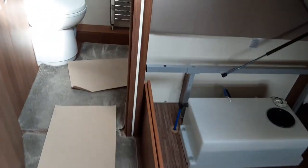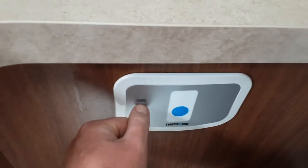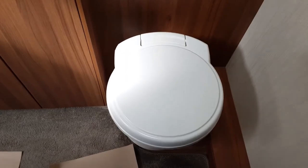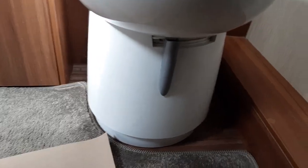The last thing to go through on this particular caravan is the toilet system in the bathroom. There's an electric flush on the toilet that works off the water system on board the van, and a red full indicator light to let you know when the toilet waste cassette is completely full. The toilet seat itself does turn for your convenience; however, when removing the waste cassette from underneath the van, you need to make sure the seat is square on with the back of the toilet — if it's turned it will lock the cassette in place. Below the toilet you have a grey waste handle which you need to push over to the wall before you use the toilet, so it allows the waste to go into the cassette underneath. Put it back in the shut position when you finish, and also make sure it's back in the shut position when you are trying to remove the cassette.